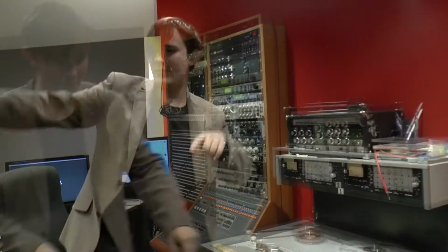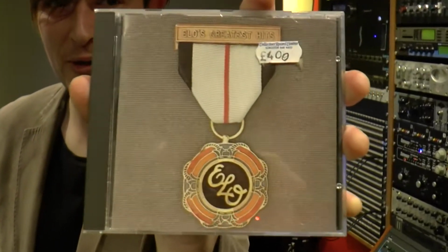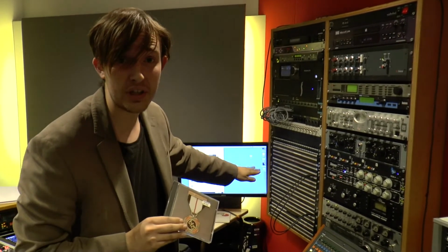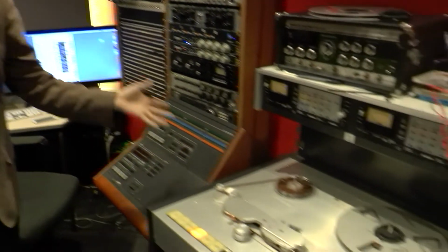Firstly, we have this stuff. It's 90% proof alcohol or higher, and this one is for the head capstan. Now, what does that mean? It just means all the metal bits are going to be cleaned with this, apart from the rubber, because this will erode the rubber, so we have a special one for rubber, as written on the label.